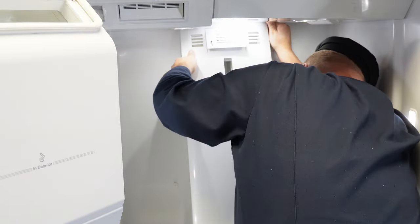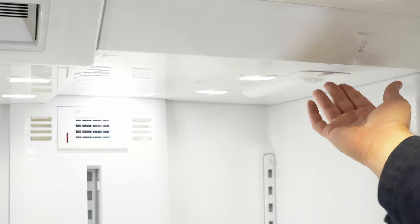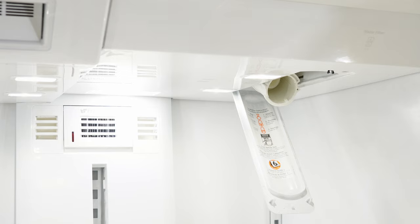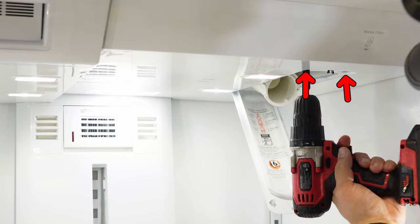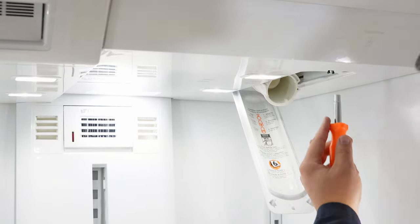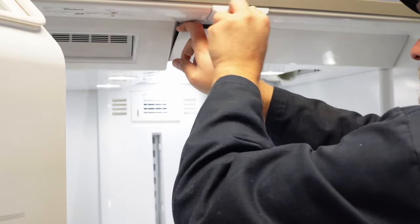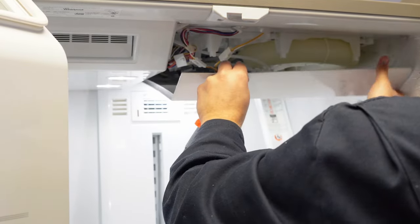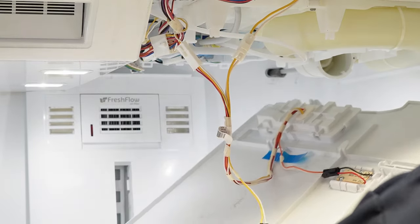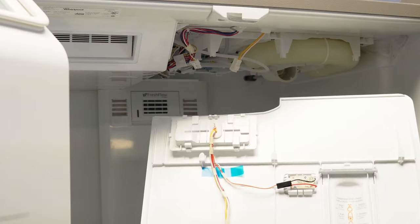To remove the air tower, first use a flat-bladed screwdriver to depress the retainer tabs around the middle of the shelf bar. This will loosen the panel so you can pull it forward. It's typically locked in at the very top of the refrigerator assembly. Sometimes you can use a putty knife to bend the cover enough to pull it out at the top, but I was not able to do that on this specific model. The more direct route is to press the water filter housing cover in, take the water filter out — which could spill some water — then locate the two screw holes and remove them using a very thin quarter-inch hex head driver. Then pry the cover panel off slowly with a putty knife. It feels like you'll rip the cover panel off because there are barbs holding it in at the rear that you can't access. Note there will be two or three wire harnesses holding the panel and light covers on that you'll need to remove.